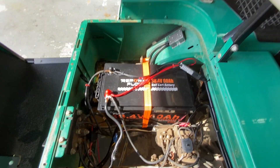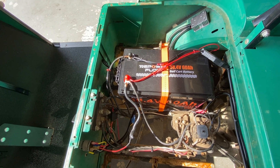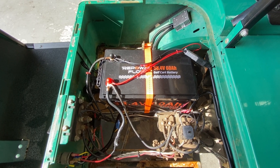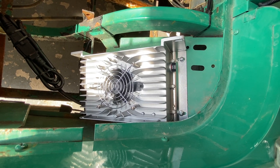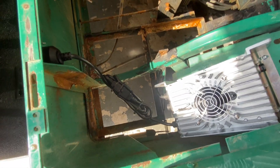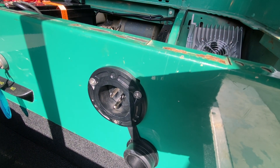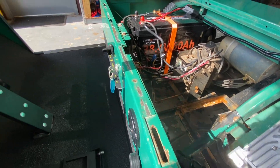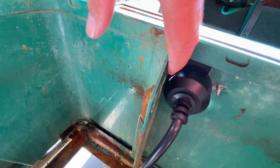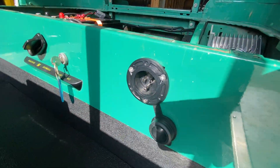Now I've got a 36-volt system, and I've gone from six batteries at 62 pounds apiece down to this one battery at about 44 pounds. I've also added an onboard charger — another couple of pounds at most — mounted on this side, with the cord running up to it. I used the original area where the Anderson plug was, cut it round with a saw to about two inches in diameter to fit the new plug. It's a little tight against the bracket there, but it doesn't look too bad installed and didn't require cutting up the cart any further.